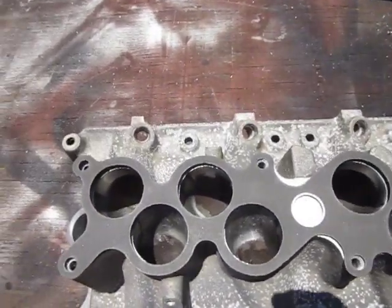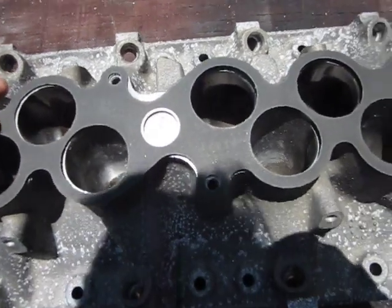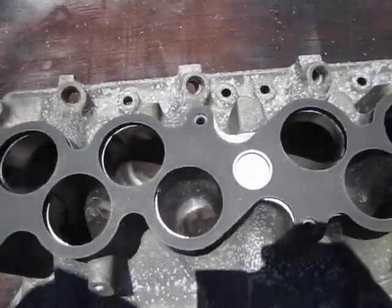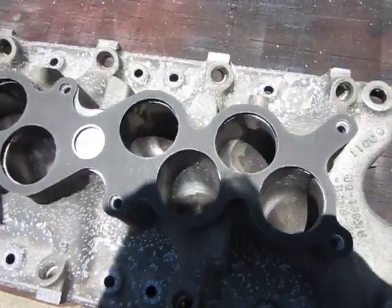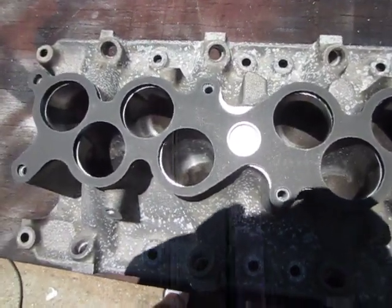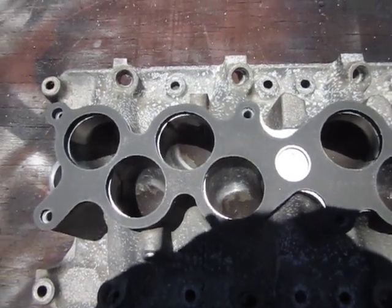And on the upper-to-lower, this is a Felpro intake gasket also — when you push it down you can see you get both holes lined up, but then you see that overlap there. The Ford Motorsport gaskets you can get at Summit don't do that, so they've got much better alignment. Just something I wanted to point out to y'all so you could be aware of it when you're putting an intake together.